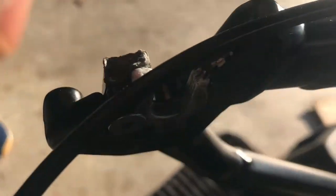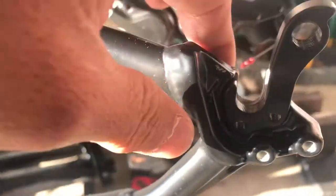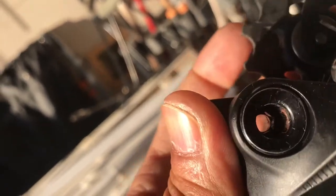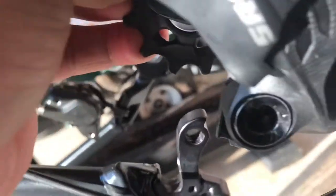What we're going to do is loosen this up — there are two bolts right here, we're going to remove those and replace it with the new hanger. This is the new one. I'm putting the two bolts in right here, same place where we got them out. There's also an Allen wrench — it's a 10 millimeter — you take that off, and right here we take out the other piece. You can see the part that broke off. I'm going to take that off and mount the new one on like that.